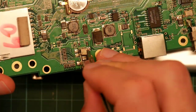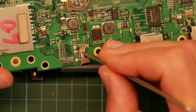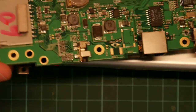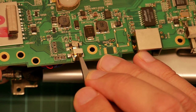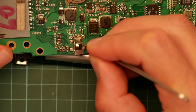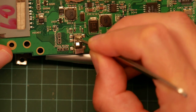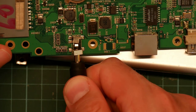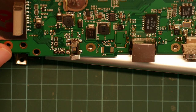So, does this thing come up? That does bend. Ah, that is the switch. Okay, I can see this piece here that bends down. There are two little tabs, two little pimples, and those would have pushed onto this before I bent it. Now it's not going to work anymore. So as the barrel connector goes in, it pushes that piece away and no longer makes contact. Well, great.